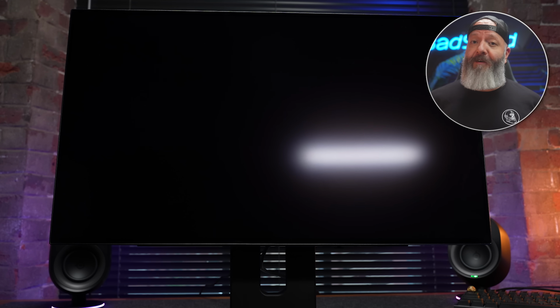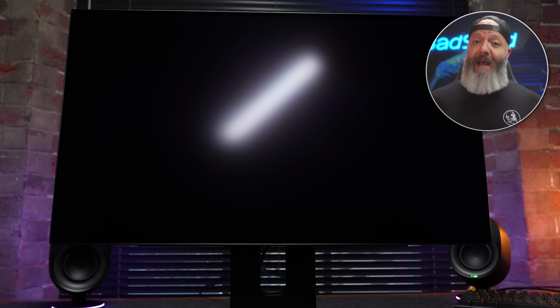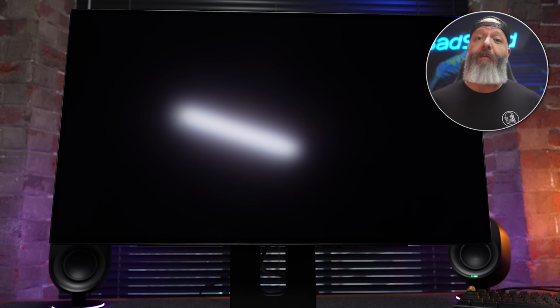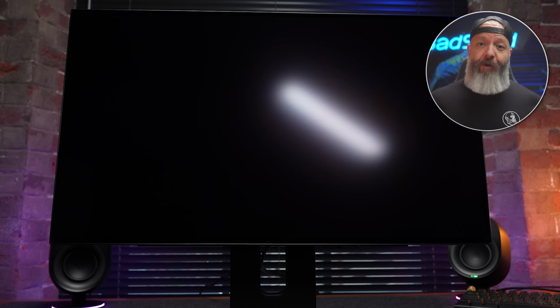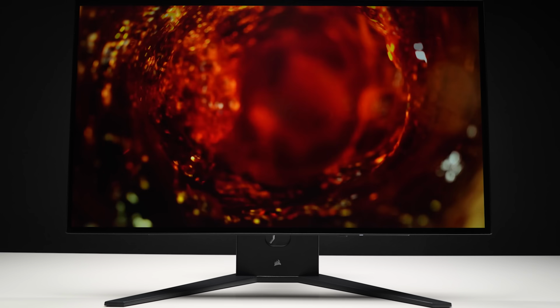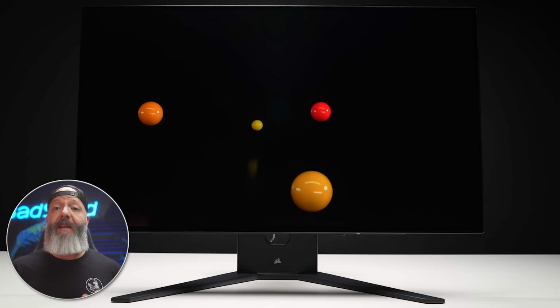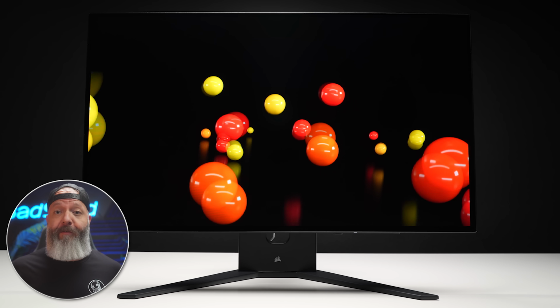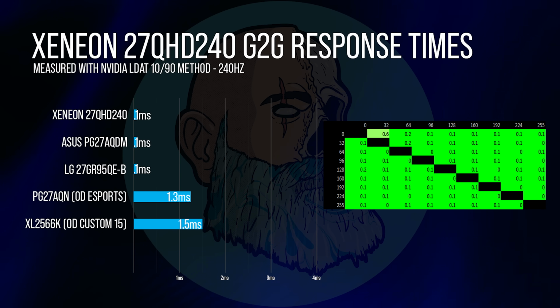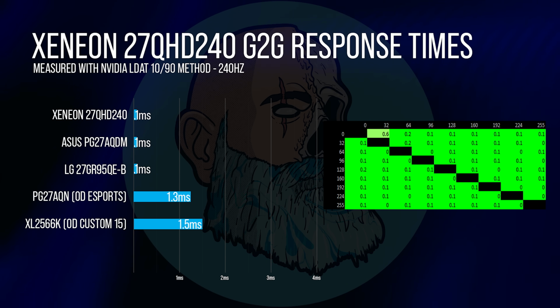As for the panel itself, this is gonna break some hearts, but it's a matte coating here as well, just like we've seen on the other two, performs very similar. So for those of you holding out for glossy, sorry. No dice. Because this is the same panel that we've seen on the other two, we're gonna get nearly all the same performance. All the insane contrast, that same 3-dimensional image, the 1440p that honestly looks more like 4K. We get all the same insanely low gray-to-gray response times that we've been seeing.